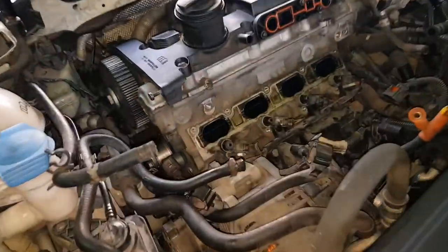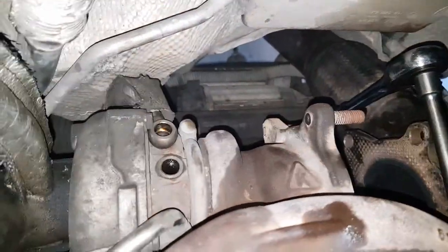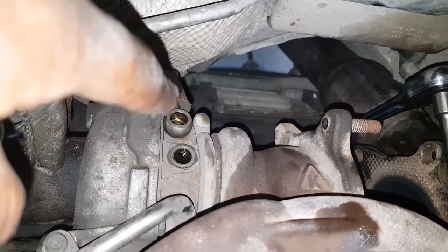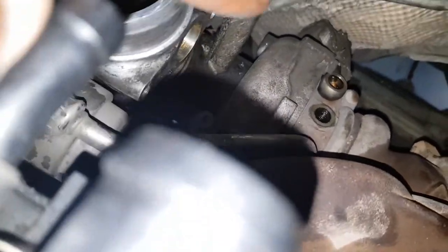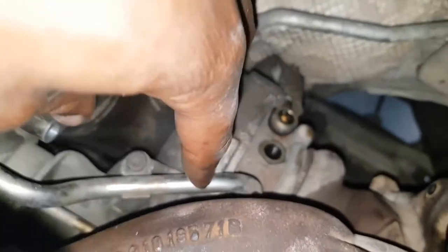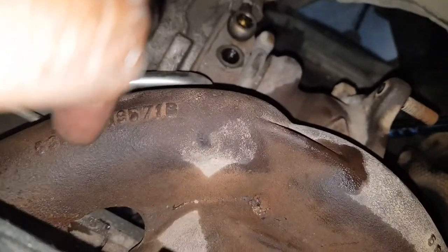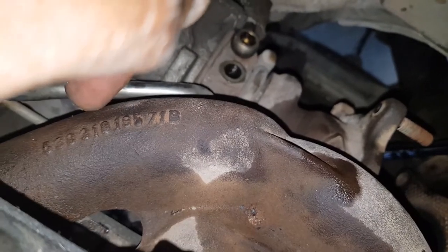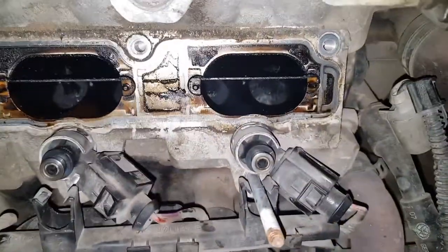I need both hands, so I can't quite show this process. So at some point this assembly process will look something along the lines like this. This here came from that hole. You had a banjo bolt going through. You have this here, my index finger is pointing on. One coolant line. Other coolant line down the bottom, you'd have most likely pulled already. The top bolts where my index finger is trying to point underneath, those have all been pulled. So it is just getting the turbo out. Carbon buildup 101.